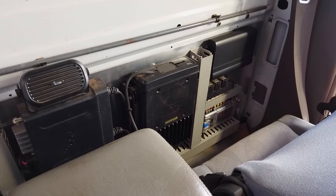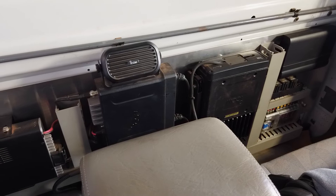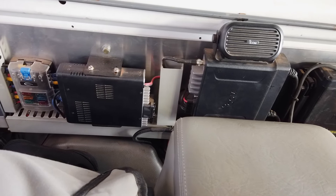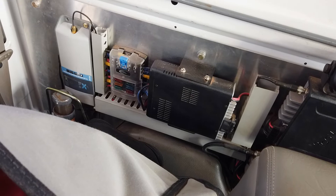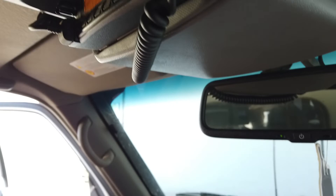Looking over this installation, we've got HF radio, commercial VHF and UHF radios, along with combination VHF/UHF radios, as well as a cell booster in this vehicle. The vehicle is also fitted with a high-speed satellite-based ADSL hotspot which can deliver ADSL speeds to workers when they're out in the field requiring to download large files or the like.